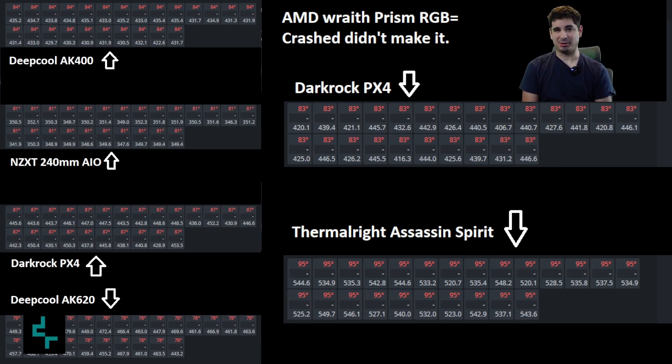The Dark Rock PX4 in the back did not run too hot, and as always, the DeepCool AK620 did the best — it has two fans and a bigger heatsink. Keep in mind some of these temperatures will be about five to six degrees cooler when there's actual good airflow. Basically what these results are telling me is that I will be swapping all of these out to DeepCool coolers — probably a mix of AK620s and AK400s. The AK400 is clearly the best in terms of value, but for a few more dollars the AK620 does a lot of work.